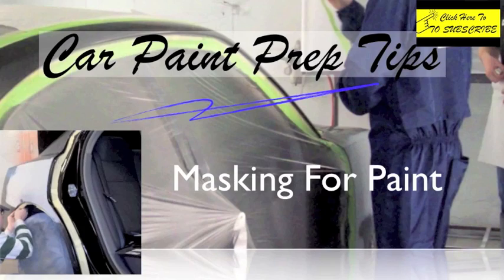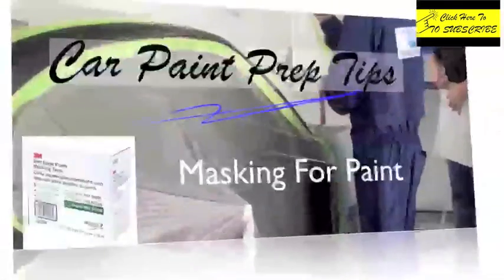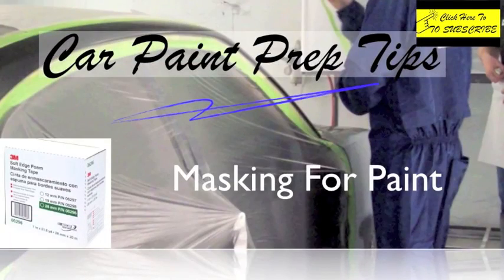That's one method. They also have aperture tape. This is a foam tape, and it works well for doing your jambs. You clean your jamb, and then you put this foam tape along the edge. Then when you shut your door or hood or trunk or whatever, it makes a seal that seals off the interior. And this works really well for masking off jambs. This is probably the most commonly used method for masking jambs.